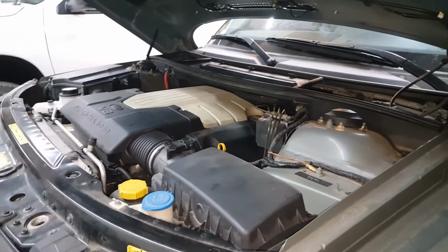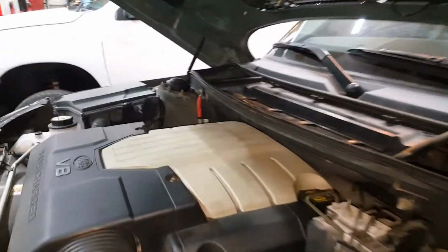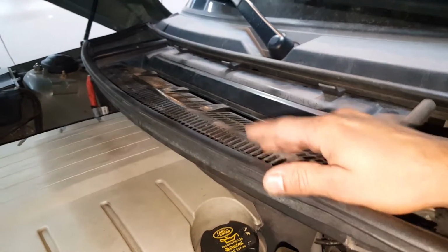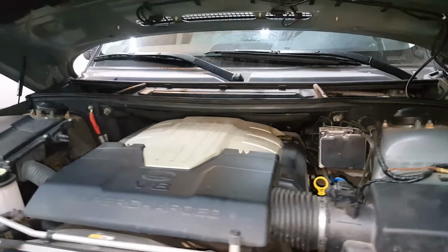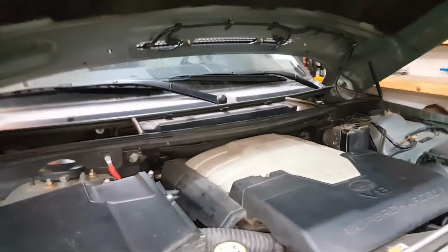So when you have your air conditioning, heater, or even the fan running, the air from the outside is pulled in through this screen here, and there's a filter that filters that air before it goes inside the cabin to filter out the pollen. Sometimes it's called a pollen filter, cabin filter, cab filter. All means the same thing.